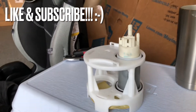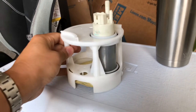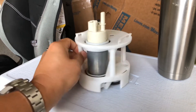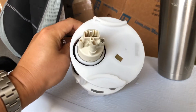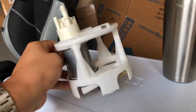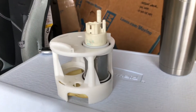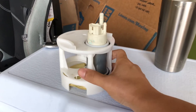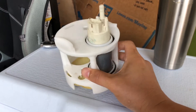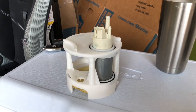The fuel pump on this model is the in-tank PZEV, which is what it's called. This is pretty much what it looks like here. You can purchase a brand new one, but in my case I got a used one. The reason I got mine used is because the OEM version is about 500 bucks. This one is off a donor car with supposedly 24,000 miles on it, so I'm gonna give this a shot and hopefully it works out.